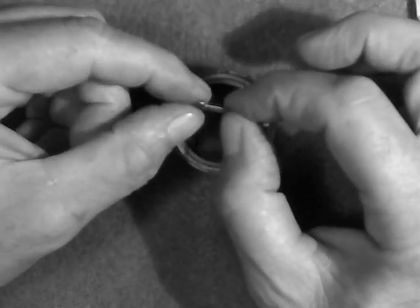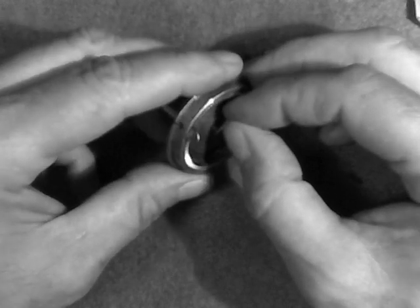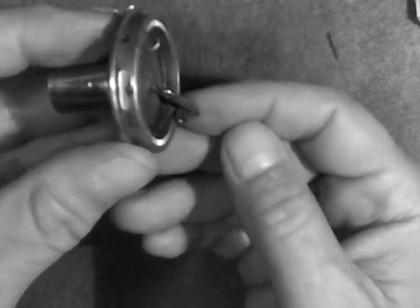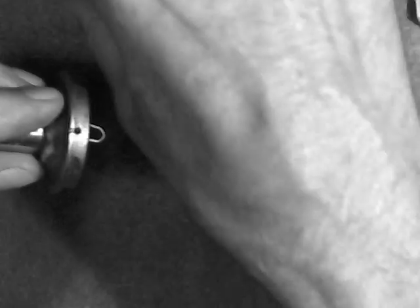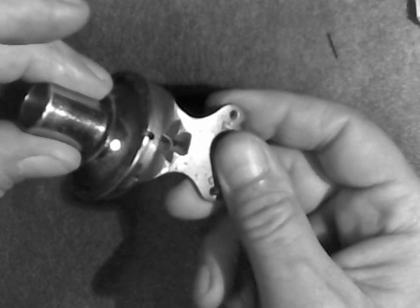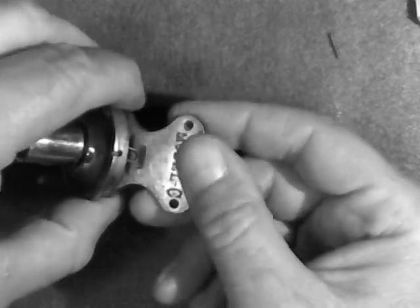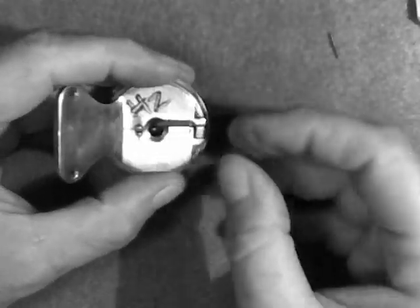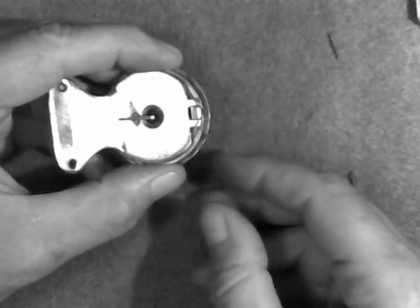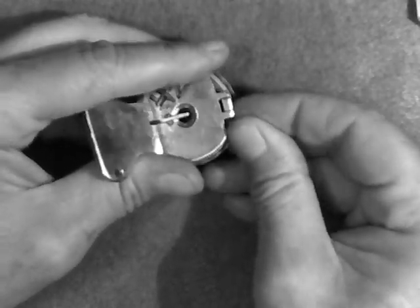Now to reinstall our stylus — there's a trick to this. All you have to remember is after you've reconnected the stylus and it's hanging freely, the stylus itself should be facing the hinge block. To reassemble, it's really simple. You take the tail weight, let the stylus fall down through the hole. Position the pin in the limit loop and line up the hinge block. Now you simply take your stylus, swing it up and stick it down in the little holder that holds the cross pin. These parts are extremely small, so be very cautious.